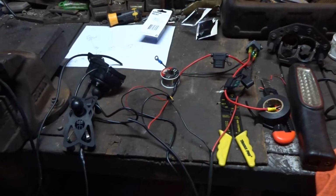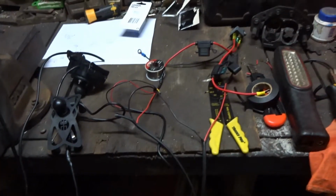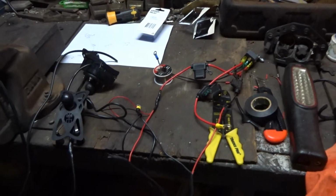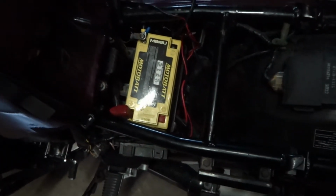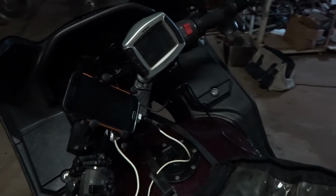20 hours later. Wiring is definitely not my expertise, and it takes a little bit of brain power for me to work all this stuff out, but I've basically got the whole harness ready to go. It all runs off this one big 40 amp relay, and all the accessories come off of there. All wired in and set up. It's just laying there, nothing's formal yet, so it's just a bit of a test, but it all seems to be on and working.